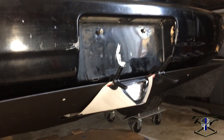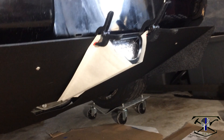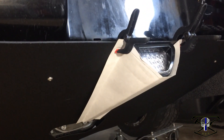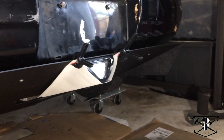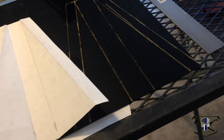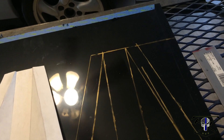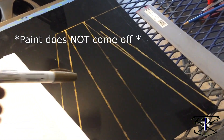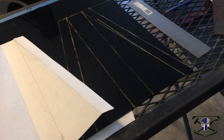Here's a look at the template I came up with. The reverse light is center-mounted, surrounded by more ABS plastic. It has a one-inch flange on either side — we're going to run rivets down and that should hold it. So now we're going to make that out of ABS plastic. The template for the center section has been copied over to the ABS plastic. I found that paint pens worked a lot better on the back side of this instead of using tape. So now we're going to go ahead and cut this and make the folds as well.